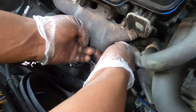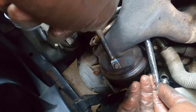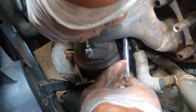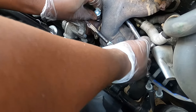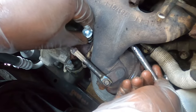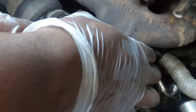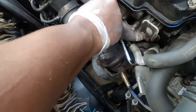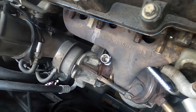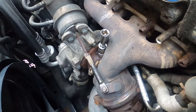The way it went in — push it through. It's going to be a snug fit. Watch right here — you should hear it kind of pop into place. There you go — you can see it seated and we heard both of those gaskets seat. Get the torx bit — this new one takes a T55, whereas the old one used a T45. So old one T45, new one T55.